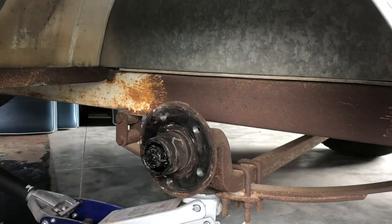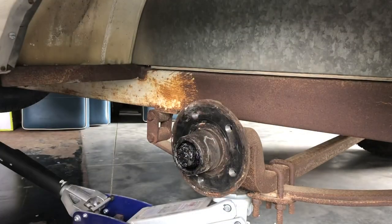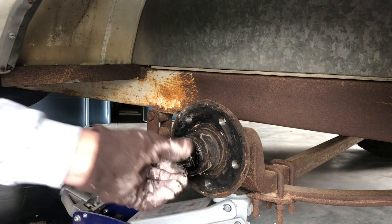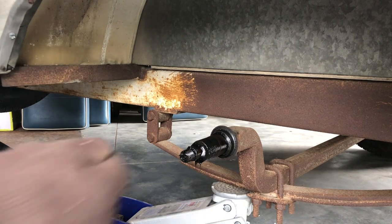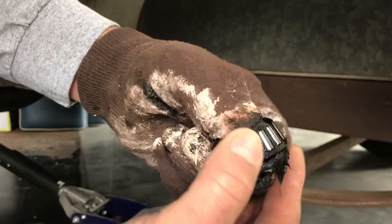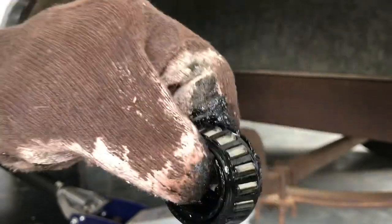This just pops off — a little bearing buddy, but not a real bearing buddy. And then this is your cotter pin — we've got to get that cotter pin out. Now we've got to take a wrench and remove this nut right here. Now we're good to look at the bearing — we're going to pull this off. We're going to look right up here and make sure it's not scarred or messed up — and it looks in perfect condition. I want to look at this bearing race. What we want is smooth, no scratches, no problems, no dents, no dings. And that's exactly what we have. So this axle looks great, the spindle looks great, and the bearings look great.